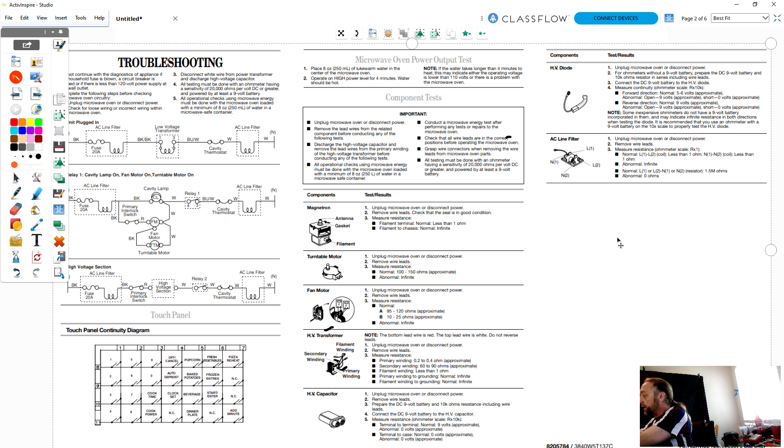When they say to check this magnetron: take the wires off, take your ohmmeter, go to the lowest scale because you want less than one ohm. On analog we have to adjust the needle every time we change the scale. The reading is zero - but this is a good working microwave. So you could have that same resistance and the magnetron be shorted internally or the magnetron itself be bad. Ohming out a magnetron - I'm going to tell you right now - I've never successfully ohmed out a magnetron and then replaced that magnetron.